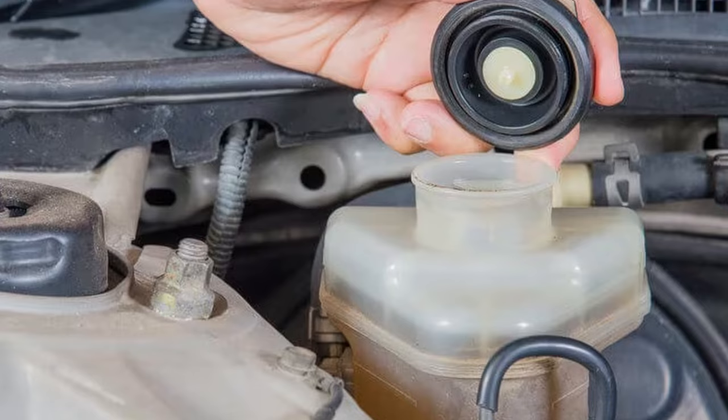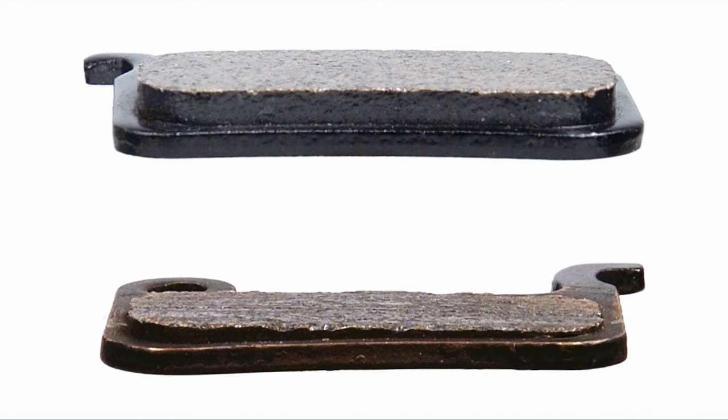When we talk about squishy, that's still your brake pedal only moving a certain distance towards the floor before it creates pressure. If you've got that squishy brake problem it's probably time to go check your brake fluid, bleed all your brakes, maybe change those pads.